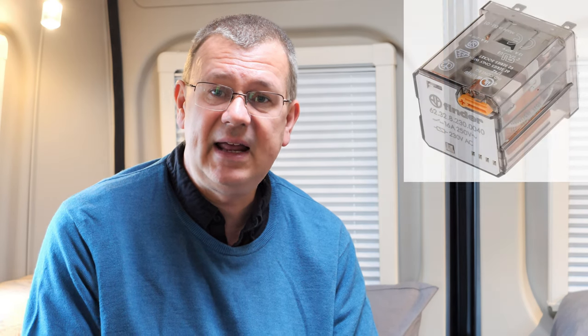In terms of setup, there are a few different ways you can do it. A lot of people put in separate inverter plugs, but what I wanted was to be able to use the already-installed things in the van — such as the microwave and the electric hob plate — without needing to switch plugs over, and also just use the existing sockets as required. So I decided to fit a relay to switch between the mains inlet and the inverter outlet to feed the sockets, depending on whether the inverter is on or off.